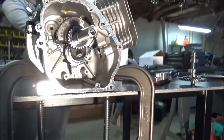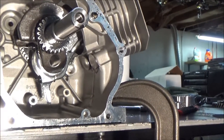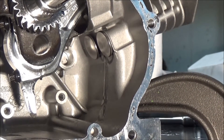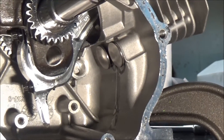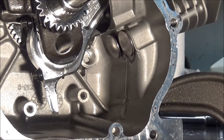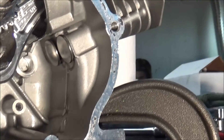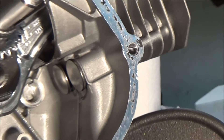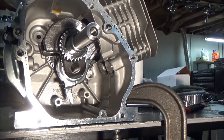Onto the bottom end — you can see the lifters are stuck up in there. I just used some assembly lube, which ARC says to use on the rod. The assembly lube pretty much keeps them stuck right up there so when you go to slide the cam in they're not going to be hitting the side of the lobes or anything.